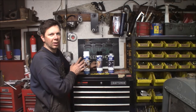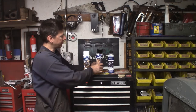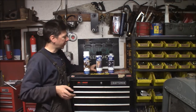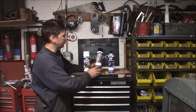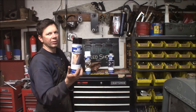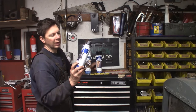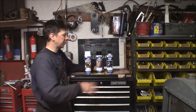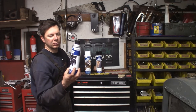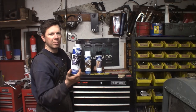I'm going to use the converter first on the harshest rusty parts. The second product is rust encapsulator — I'm going to use this as a primer for the whole chassis. The rear half of the frame is brand new metal but has a little rust; I've hit it with a flap disc to rough up the surface. I'll spray the whole thing with rust encapsulator over the original paint, new bare metal, and over the rust converter. The third topcoat is chassis black — satin black, an epoxy-fortified coating that's oil resistant, weather resistant, and UV stable.